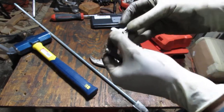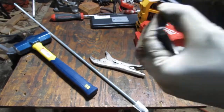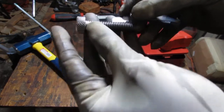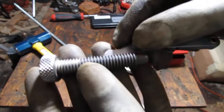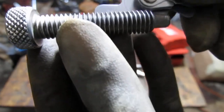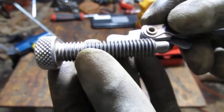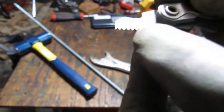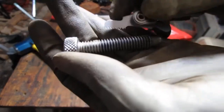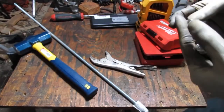And so you take these thread gauges and you go like this. You're looking for a perfect fit. See how beautiful that looks? So get out of the shadow. Okay, now this has a number on it. It's hard to see, but it says right there, 14. That means it's 14 of these grooves in 1 inch, right? So that's how you know.